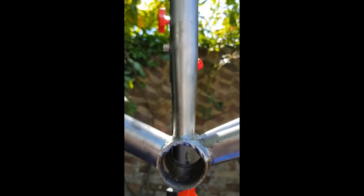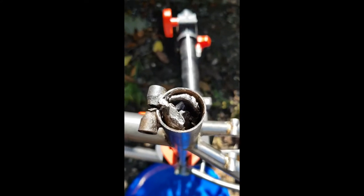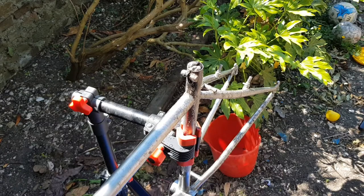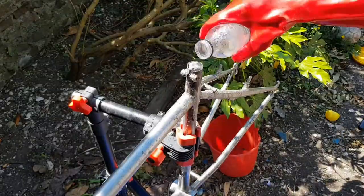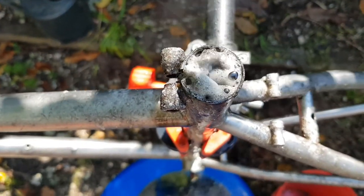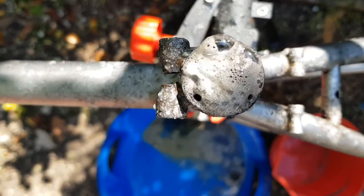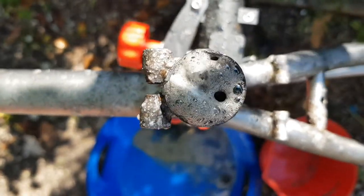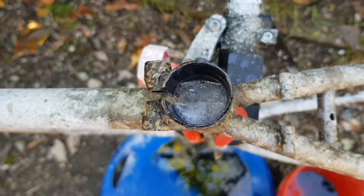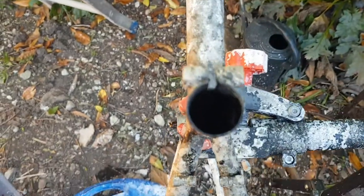That created my sodium hydroxide solution. I had to block the hole on the bottom of the seat tube in the bottom bracket area, then filled the seat tube up with the solution and left it to bubble away. I filled and emptied the frame a number of times over the course of about four hours, just had to be patient — and eventually it disappeared, which was a massive relief.